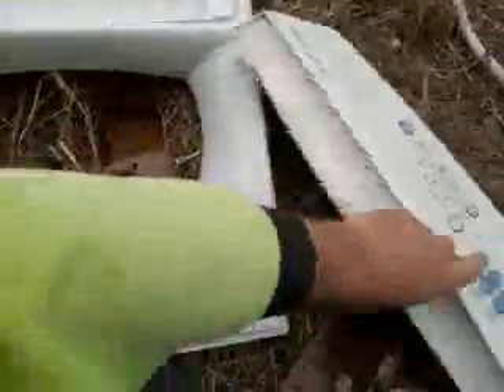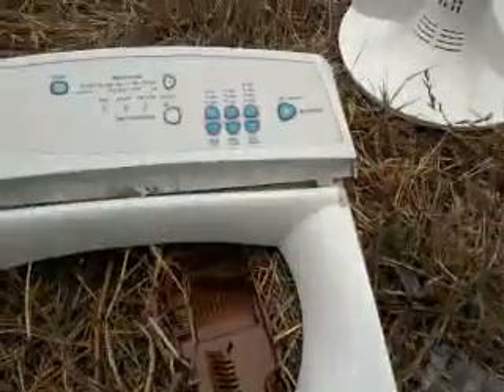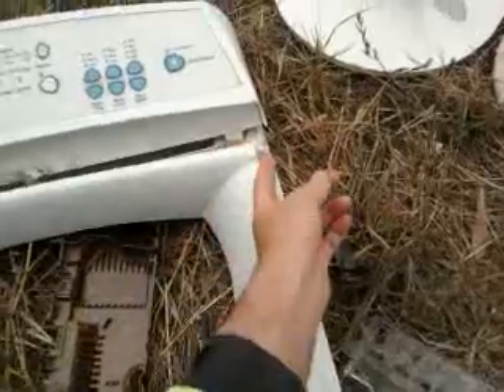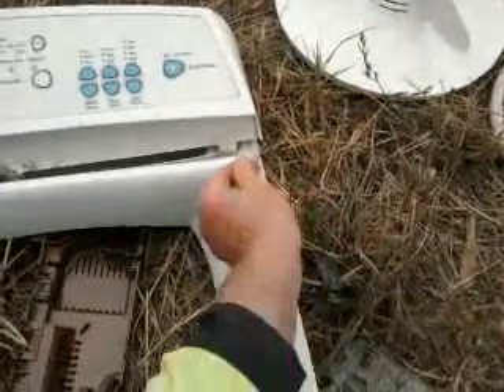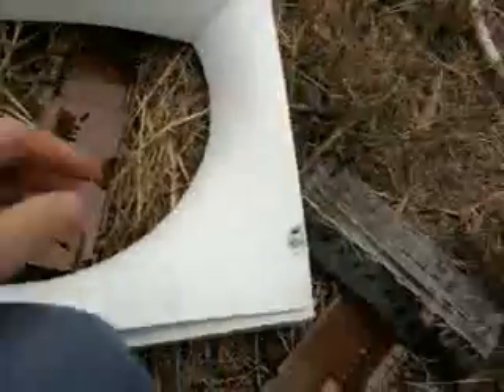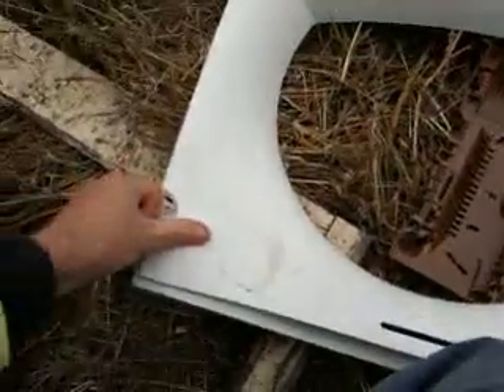First you start with the top of the washing machine - that's basically the guts of one. When you open it up, grab hold underneath the lid and pull it outwards to get it up a little bit and it'll just pop straight off, getting your whole lid off. Then you have these little rubber grommets that sit in there - just start pulling them from the side and get the screws out.